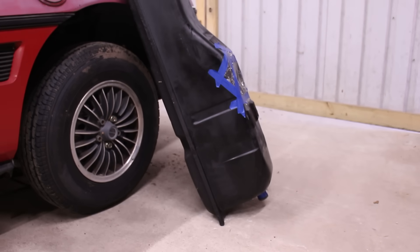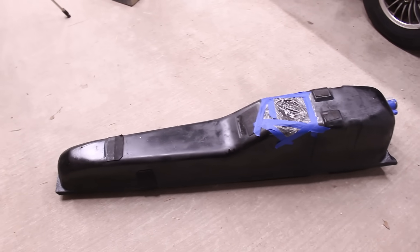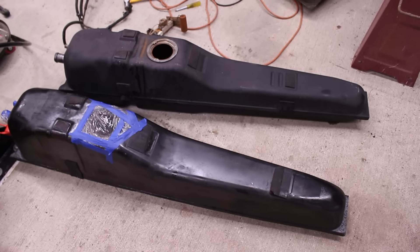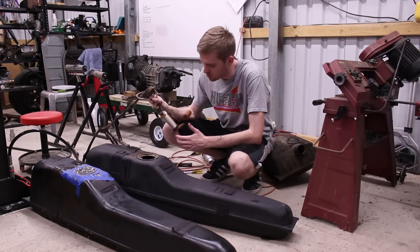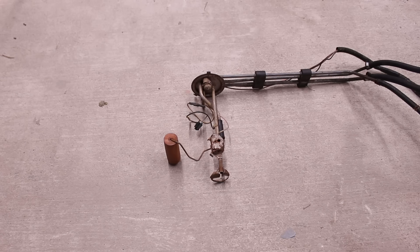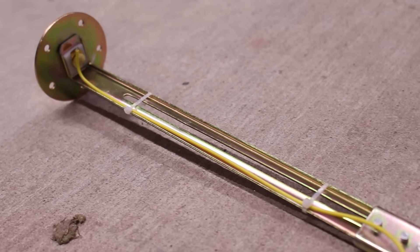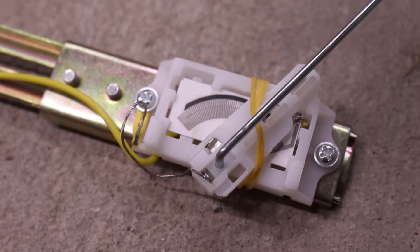I found a pretty decent deal on a completely rust-free tank and didn't want to pass up on it. As much as I trust the steel stick I used on the original tank, using an ultra-clean, pinhole-free tank would give me complete peace of mind. This tank is from a 1987 Fiero, and you can see it's not actually the same as the older ones — the form was optimized for higher fuel capacity. I also want to address the rotted-through fuel level sender. I could buy a whole new assembly for around $150, but instead I'm using this generic fuel level sender. A level sender is just a float attached to a potentiometer, so as long as you get one with the correct resistance range — in my case 0 to 90 ohms — it should work fine. The only thing to do is modify it to work with the original assembly.